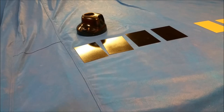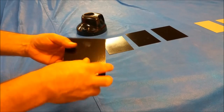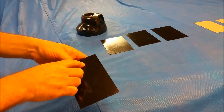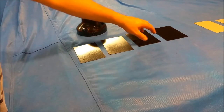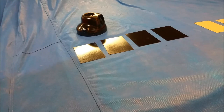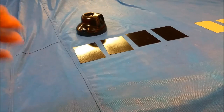On the bonnet of the XC, we've got a headlight bucket that's just waiting to be cleared, and we've got these four swatches. What we're going to do is tape off about two thirds of it, leave one third black, do the rest silver. So we can have four samples: a silver one, one with the high-flake silver glitter, one with the colour glitter, and one with both. Clear them off, stick the red stripe on — then we've got reliable swatches for the paint on the tank, side covers and so forth. I haven't used that glitter product before, so I'm doing this for Dave and for me, so I can figure out how it behaves.